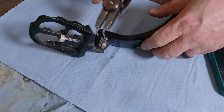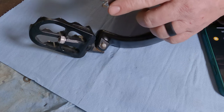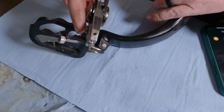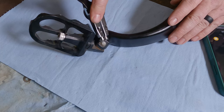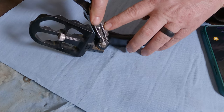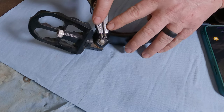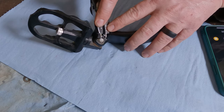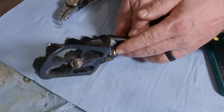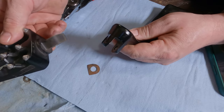We have our snap ring pliers. I'm going to spin the snap ring so you can see it easily. I'm going to take the two pins here on the snap ring pliers, put them down into the eyelets and squeeze, and you'll see the snap ring spread apart. Hopefully, once it spreads apart you should be able to lift it right up off of there — don't go too far or you'll bend it. Set that off to the side. From there, you should be able to take this pin and push it up; it should slide out of there. And from there you can actually take the foot peg off.